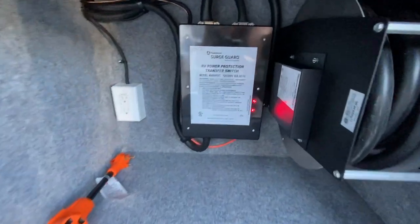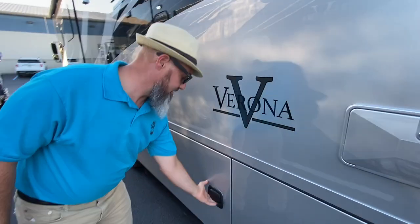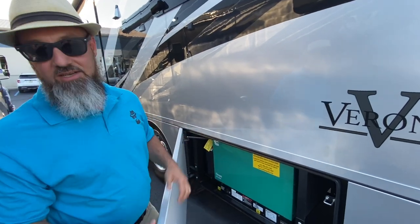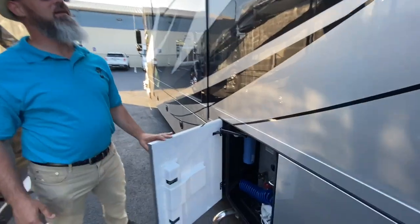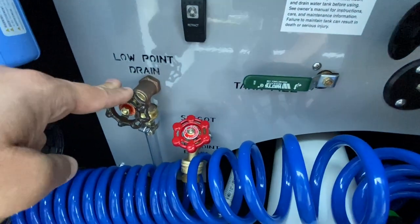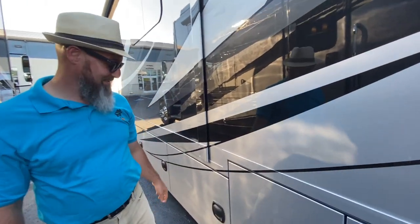You have an auto transfer switch with a built-in surge guard, a 110-outlet on the GFI circuit, an LED light, and an electrical step-down from 50 to 30 amps. Next is the Onan quiet diesel generator — more than enough to run everything in this coach simultaneously. They put four screws in there so if you remove them you can pull the generator right out for a major service. Here's your wet bay — they hydro-cut all the labels. It has a power hose reel, black and gray dumps, sewer flush, a tank-and-city-water diverter, a low-point drain for the plumbing system, an outside spigot, and full-house filtration. They even give you space to store your sewer tube right there.